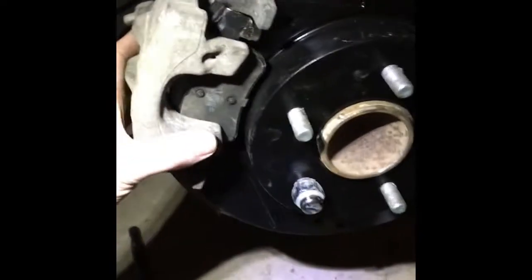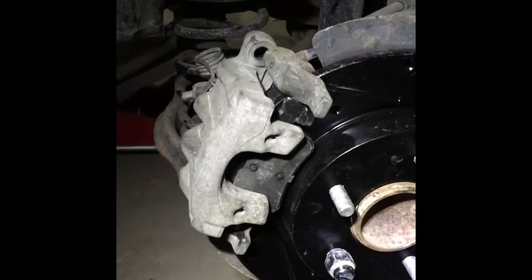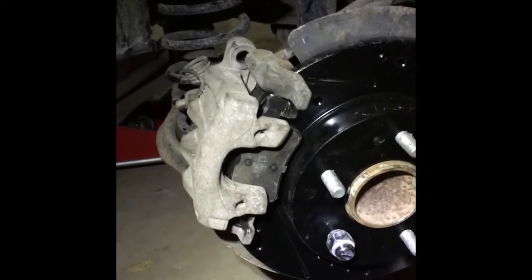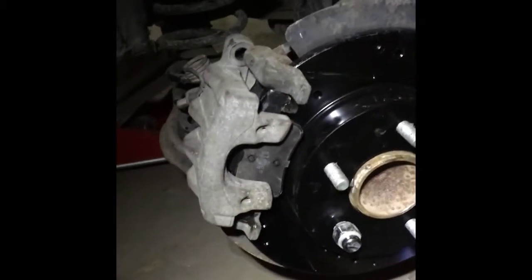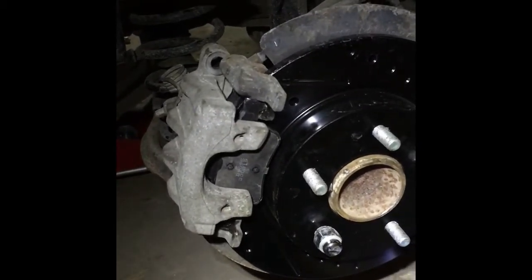So finally it looks like this, and now I can finally screw all the bolts in and make it done. Okay, this is a good lesson for me. So rear pistons are a little different. You need to screw them in, like you need to go clockwise and not just squeeze it in. Obviously it didn't work for me, but now finally I'm getting it.